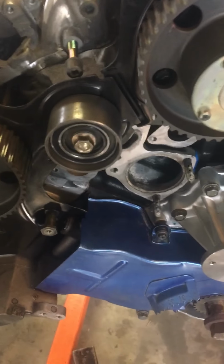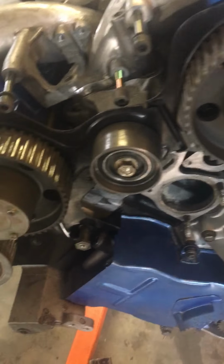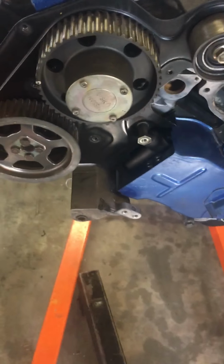There are new freeze plugs in here, but checking, the casting is still inside. So the block work that you normally got to do, where you knock out the rear freeze plug and port it out so that cylinders number 5 and 6 have better cooling, isn't done. There's just so much flash casting that's inside here. Obviously, you can see all the way through to the other side. There we go. You can see clean all the way through it.